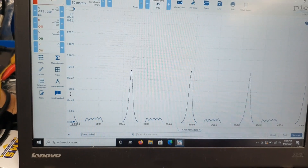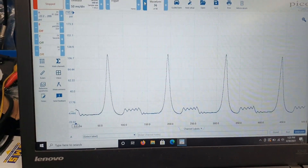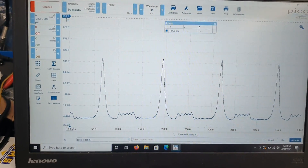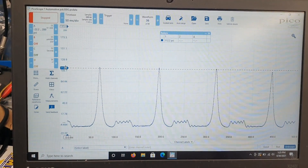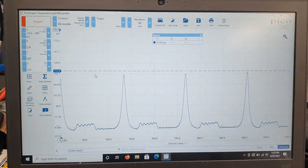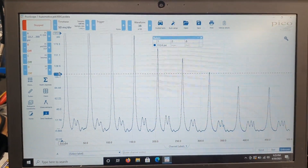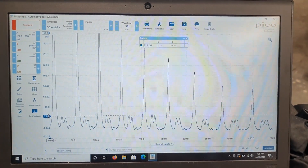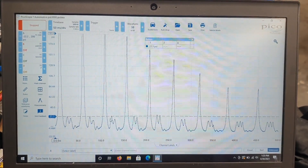We're a little off the screen — let's bring that up. Going to where we're idling, let's bring the cursor down and see what we're reading. Very similar — 113 to 114 psi, which changes slightly depending on whether the idle speed is raising a little bit. Very similar to the Ditex. Let's go to where we're revving it — our back pressure comes in around 20 psi, almost exactly the same as the Ditex transducer. That's subjective to how much you put your foot on the accelerator and we tried to replicate it.